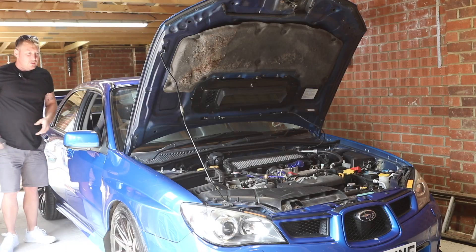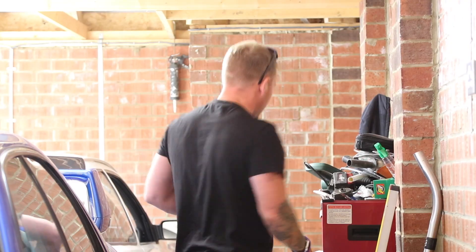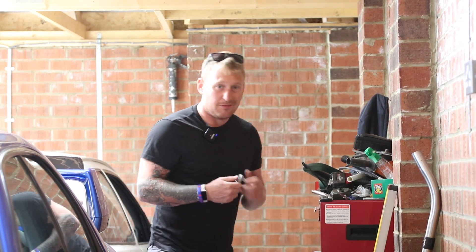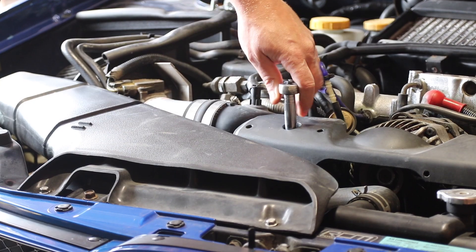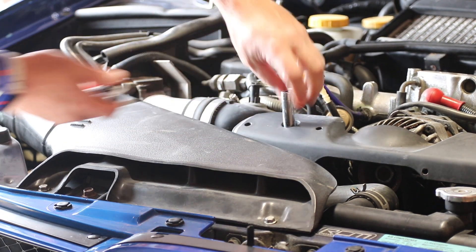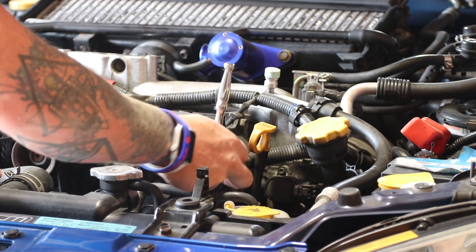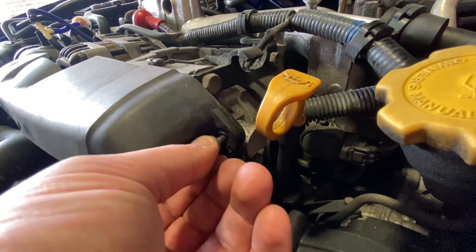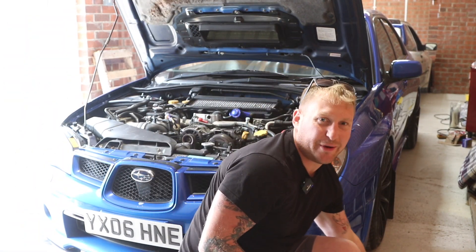What we're going to do is adjust the belts — it's a pretty simple job, you just need some basic tools. I'll get the tools and show you what you want to do. My toolbox is a bit of a mess at the minute, I've just had the garage built and haven't had time to sort all my gear out. We're going to start with a 10mm socket, and I'm going to begin by just removing this cover here — it's one bolt and one nut.